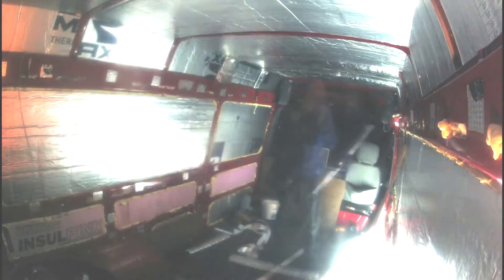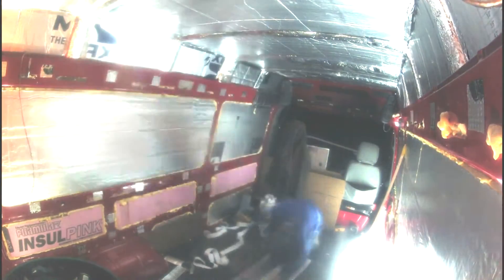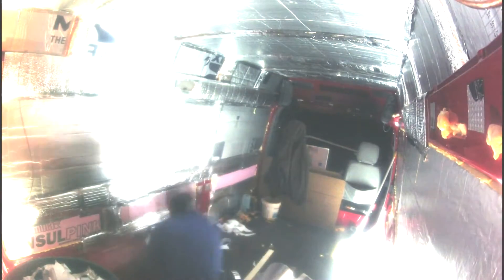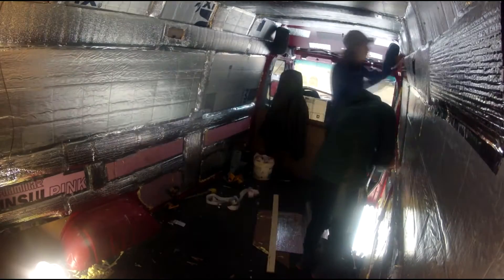Once I finished securing all of the pieces of insulation, I took Big Gap Filler Expanding Spray Foam and sprayed it anywhere I could in the ribs in the walls, just to fill them up and have a little extra R-value in the walls and in the doors to minimize any heat transfer I can. The next step in that same thought process was taking Reflectix — foil-backed bubble wrap — and foil tape, cutting the Reflectix into strips and covering up the ribs that were still exposed, so any sheet metal that was exposed I'm trying to cover up.